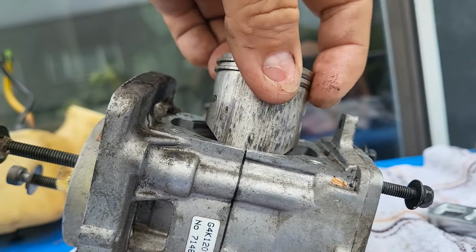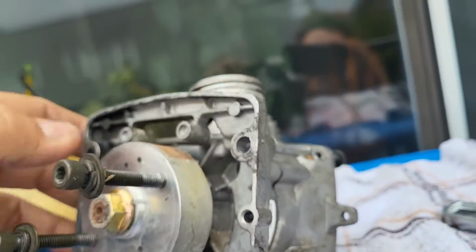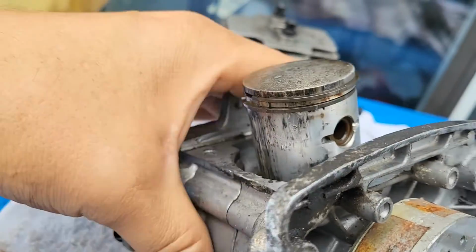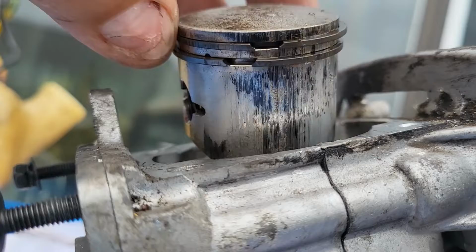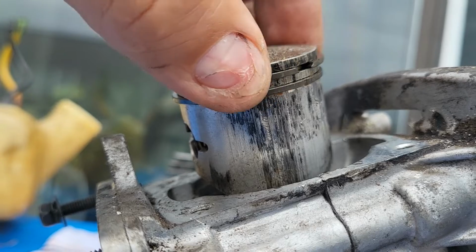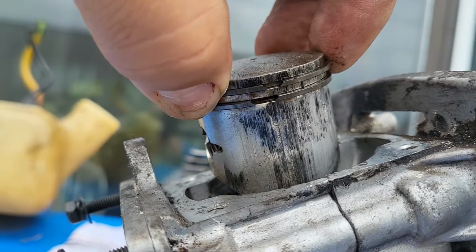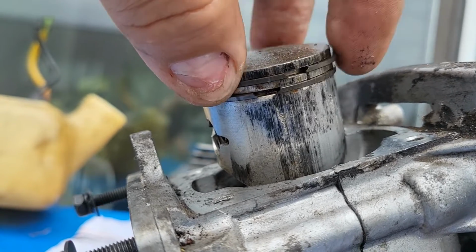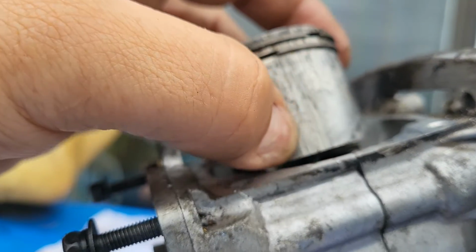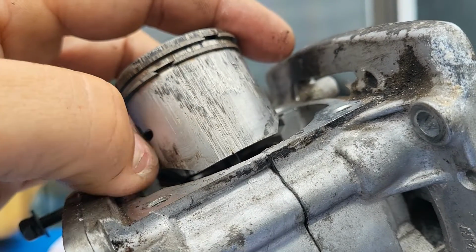And I'm just feeling around the piston rings. So when you look at, let's see here, just right here where the piston rings go, you see how they're kind of grooved on the ends there? When they're in the cylinder, they go really tight together and they expand out on purpose to touch the cylinder walls. Now, when I look at everything else here, yeah, there are rough ridges right there.